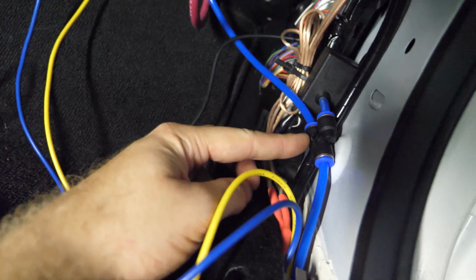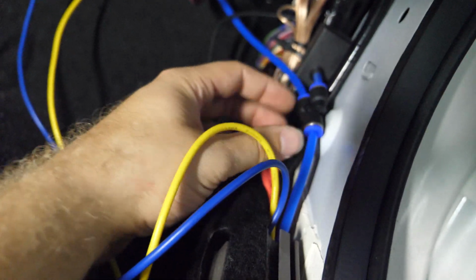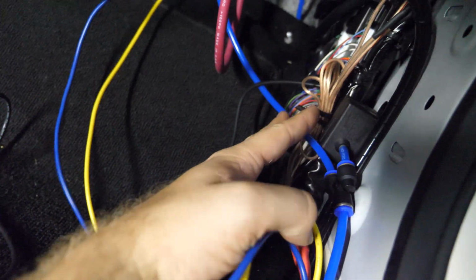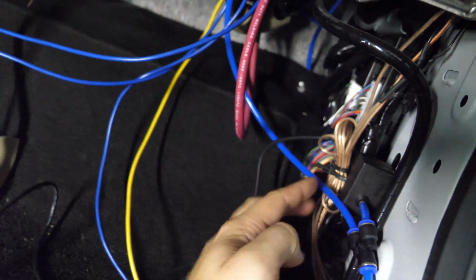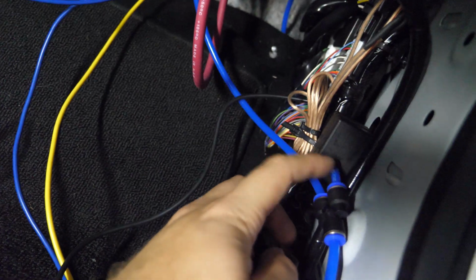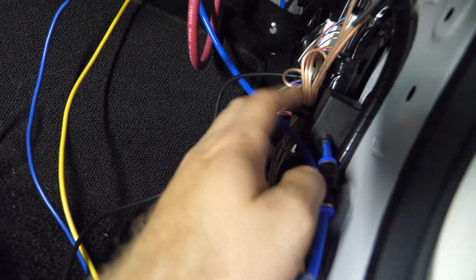This right here is a little T-joint essentially that came with this air hose fitting. It's basically a push connector where each of these airline hoses just pushes in here, and this is the hose actually leading to the manifold. And this is the hose leading over to our fuel pressure regulator, and then I've just got that additional tap here to be able to use this as my boost as well for the gauge.